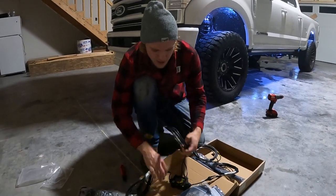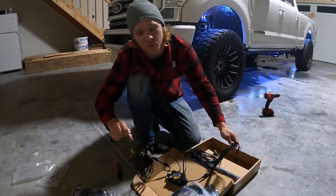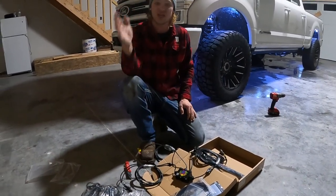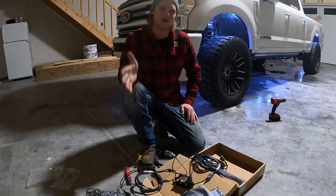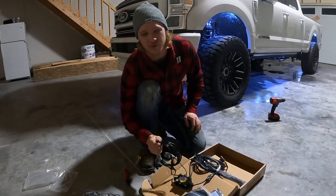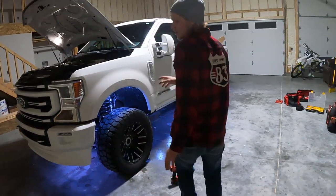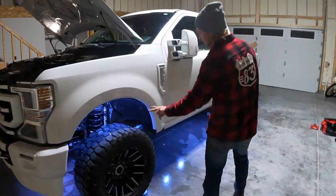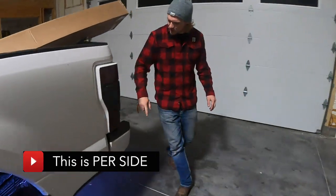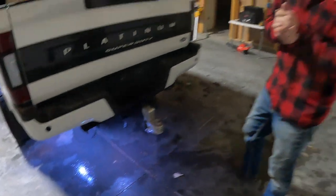This goes to your power, this to street legal if you've got it, and these two leads go to the two channels — one to each side if you want. The advantage of two channels is you can change colors independently: green on one side and purple on the other, rainbow on one side and white on the other, whatever you want. We chose to run both off of one channel since I won't really offset them. As placed on the truck: two in the front, two in the fender, six under the body, two in the rear fender, two under the rear corner, and one under the receiver hitch.